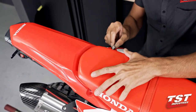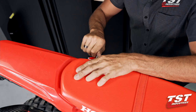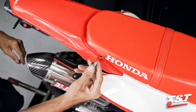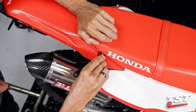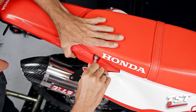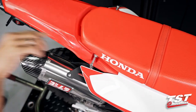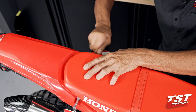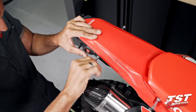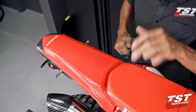And now we're going to replace the fasteners that hold these components together. I just want to note that when you do this, I recommend being very careful that the actual shoulders on these washers, on the spacers, are concentric with all of the components so that you don't clamp down on any of the plastic components and squish them, deform them permanently. So I do this by hand until I have metal to metal contact. That's pretty much it up here.